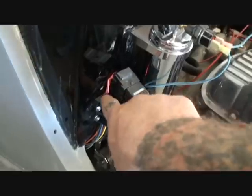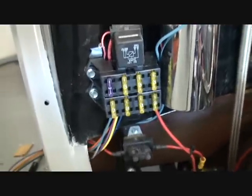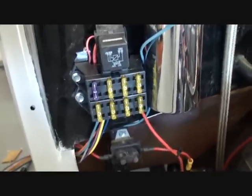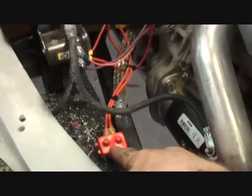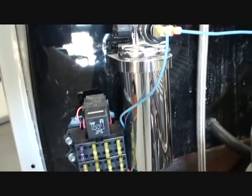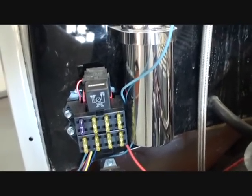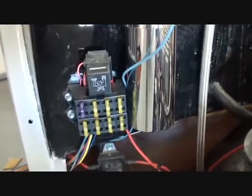This is a waterproof setup, encased with plastic resin on the back. We actually got — one, two, three, four, five, six, seven — we got eight more circuits. We got three circuits that are hot all the time and then we got five keyed circuits. That runs down through this relay right here, this breaker switch. And this is the solution — this is what you want to do if you run into this problem. You're going to have to add on to the system that you got. That little bastard there is not cheap — that's 98 bucks.